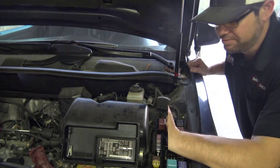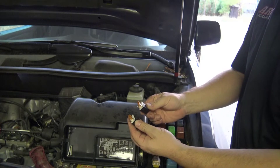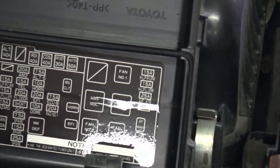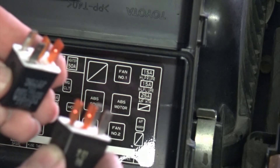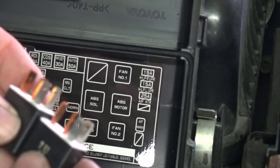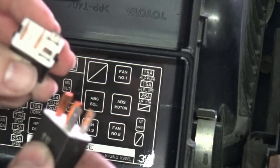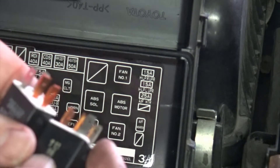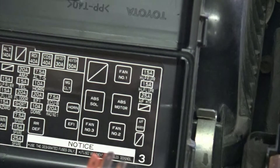So I'll switch them now. Both relays have the same number of terminals and same configuration. What you'll notice is that they have two copper terminals and two silver terminals. The smaller silver blade terminals go to the control circuit of the relay. The larger copper terminals go to the switch circuit. They're exactly the same configuration and same part numbers. I'm going to put this horn relay inside the EFI relay's location.